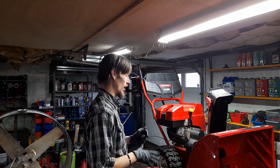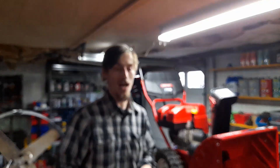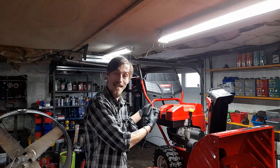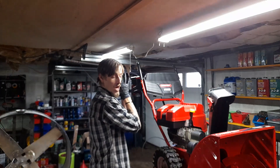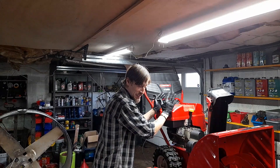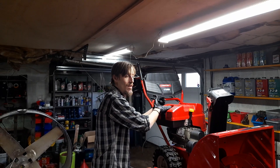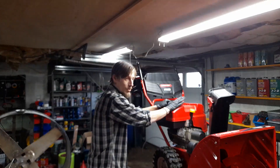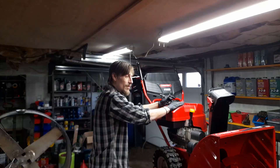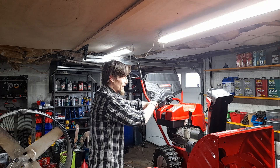I'm going to finish this, blow that out, finish draining the fuel, refuel it, then run the unit until it gets good and hot. That also lets me know the TruFuel made it into the engine and all the way through the fuel system 100%. Once you're confident the TruFuel or Aspen fuel or comparable product is in there, make sure before you call it good and fill the tank that you start the equipment — I recommend at least three to five minutes of run time. I'm going to take it outside to do that, since I don't feel there's really adequate ventilation in here.